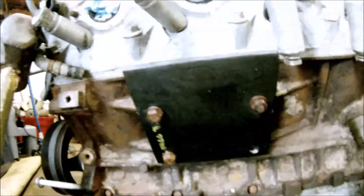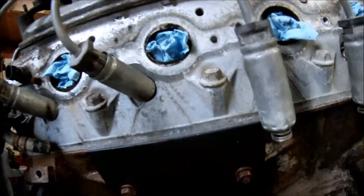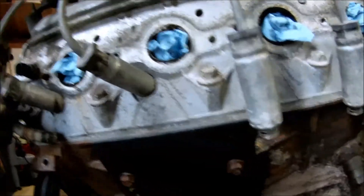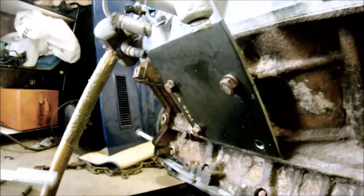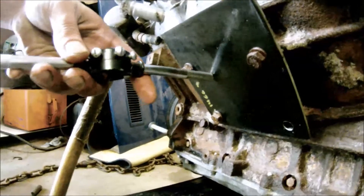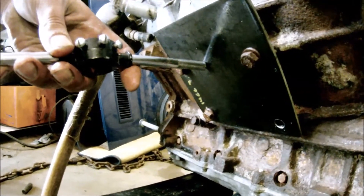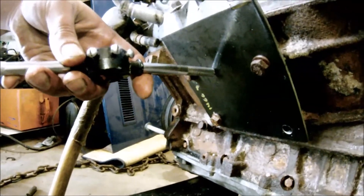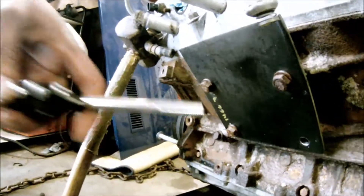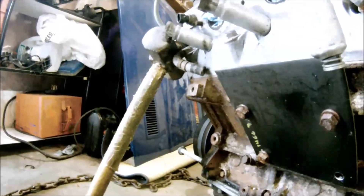What we're going to be doing for the mounts — I'm not sure what angle that is, maybe a 60 degree block or something like that, so that would be maybe 30 degrees off. We are going to be taking that square plate and putting it on an angle to make it parallel to the ground. So we're going to be putting it on the chop saw, chopping in the appropriate angle, welding it on, and then we're going to do some triangle braces up from the base to the top. It's going to sit on those motor mounts and we should be good to go.